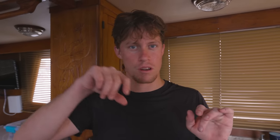We moved inside to give you guys an update because it's windy outside. All the grinding is done. On one side we could see the wood coming through, which means the fiberglass wasn't that thick there. My strategy was to taper off the grind so the middle section where the two pieces join is the lowest point — like a bevel — but it was really hard to achieve with the grinder. I just did my best and now we have the fiberglass cut, so it's time to join the section we cut out with the deck.